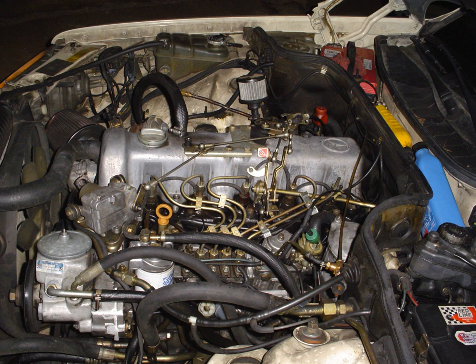Pencil glow plugs were provided on all OM617A engines. In 1978, the OM617.950 was mated with the Mercedes-Benz W116 to produce the North American market-only 300SD, the world's first production turbodiesel sedan. These engines predated the introduction of tighter emissions laws, so were not fitted with EGR. Power originally was 111 PS at 4,200 rpm, torque 228 Nm at 2,400 rpm.